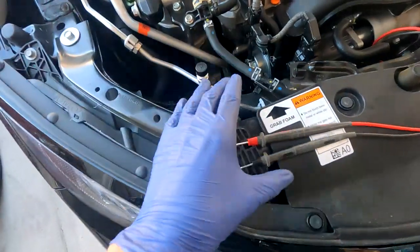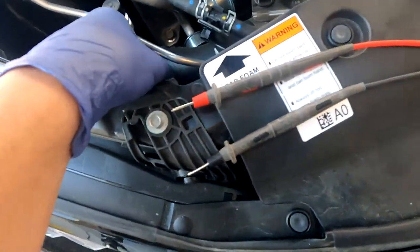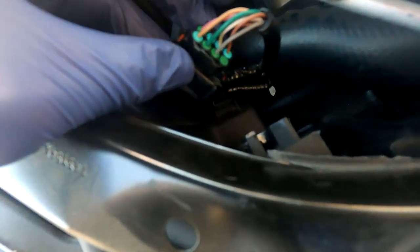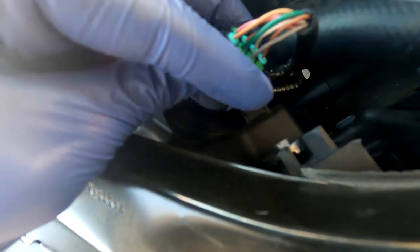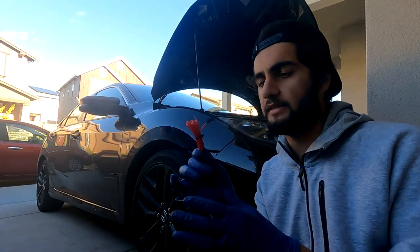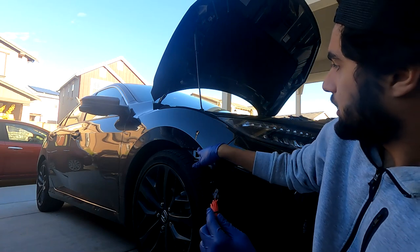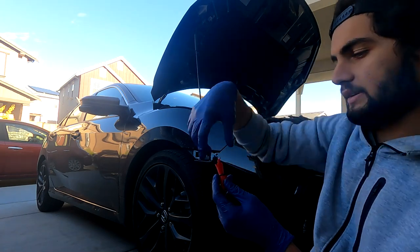I tested it with a voltmeter, turning on the turn signal and checking each wire. On the back of the connector there's one side with four wires and another side with only three wires. On the side with three wires, the middle wire is the turn signal — it's green on my car, though it might differ for others. You'll want to grab one of the wires from the box — it's not cut to size so you'll need to cut it — and feed it so the plug end comes out through here while the other end is on the connector side.